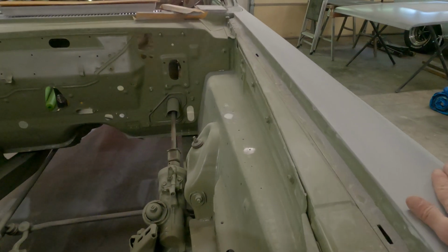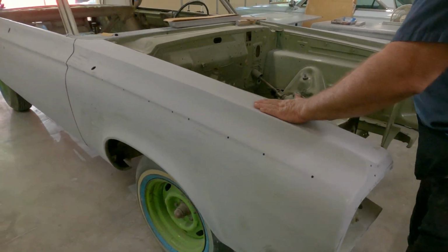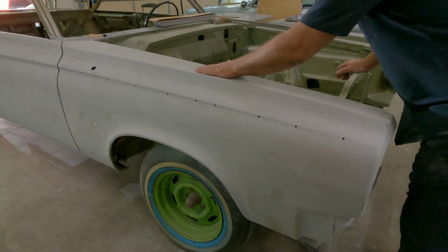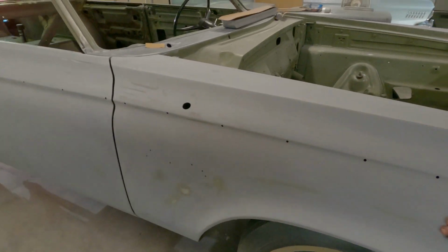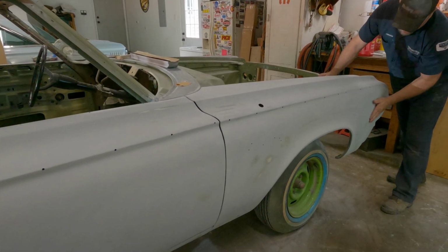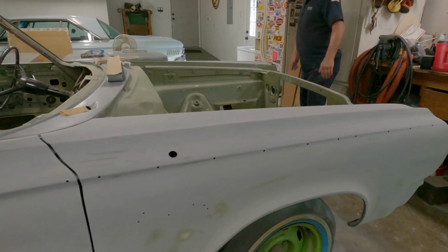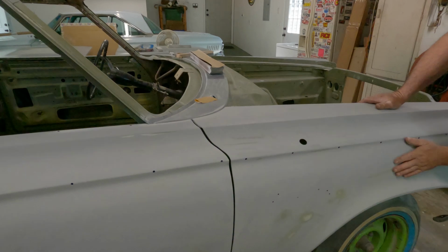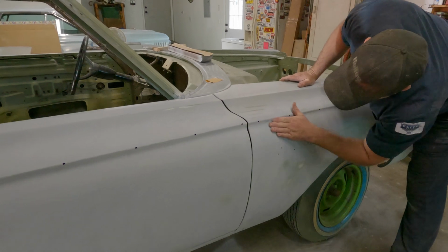Yeah, this is good. You get into the green. Yeah, that's right. Okay, well, I kind of thought so, but now over here I got some metal showing, and you're going to see this side's a little more splotchy. It's kind of just knocked down mostly, but I didn't take the longboard to it yet. Well, I'd take the longer one and kind of get it better. Actually, you should go over first with that. That lets you know where you're high and low.